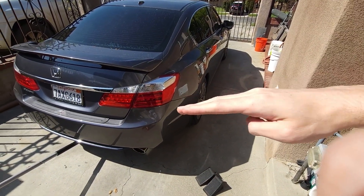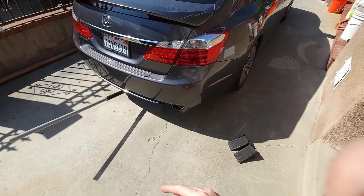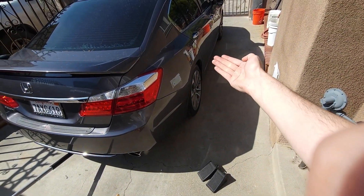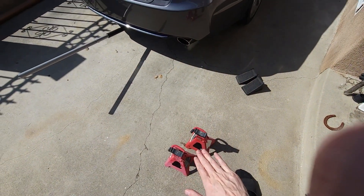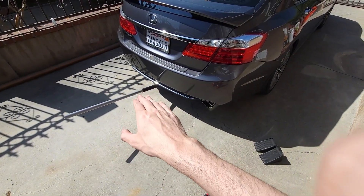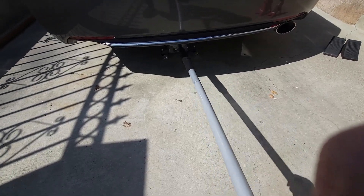I'm not going to apply the wheel chocks yet to the front wheel because I'm still raising the vehicle. The vehicle is going to move a little forward and back as I raise and lower it. My next step is to raise the vehicle enough to slide the jack stands under the rear, then lower the vehicle so that the weight rests on those jack stands — that's where you want all the weight, not just on the floor jack, because that could give out. So we're going to keep pumping until we raise the vehicle enough.